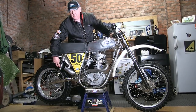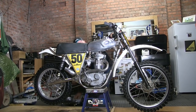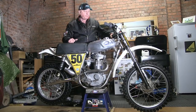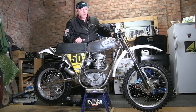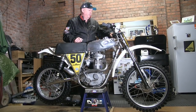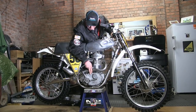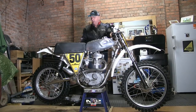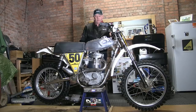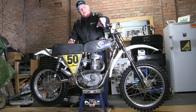We've completely revised the rear shocks — they've been stripped out for Byrock shocks set to my exact weight, so I've changed a little bit of the damping and the spring rating. The front forks have been fitted with special spring preload adjusters so that for various tracks I can either raise or lower the spring rating depending on the type of track I'm racing on. We've also fitted new Dunlop tires front and rear, the whole engine is completely stripped with new bearings throughout, new 520 chain, new sprockets, a new throttle, and some nice retro Magura grips.